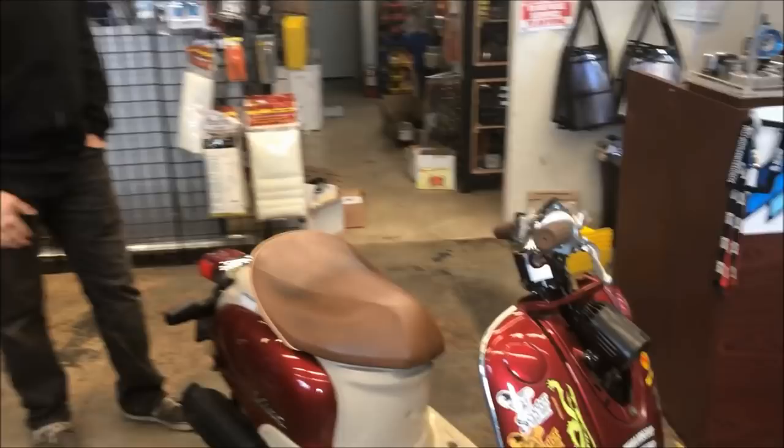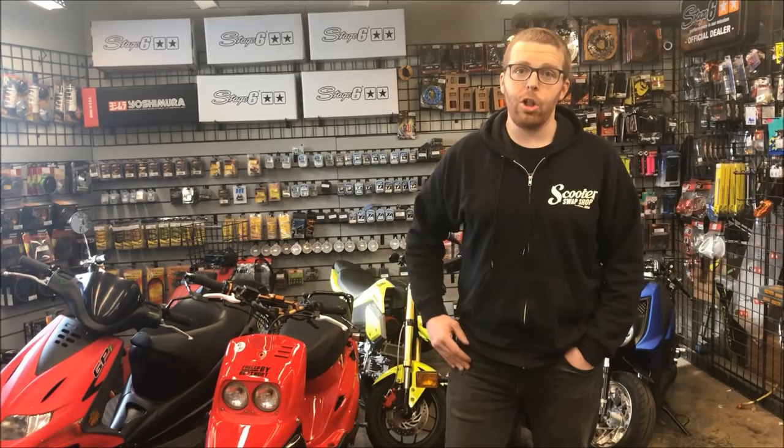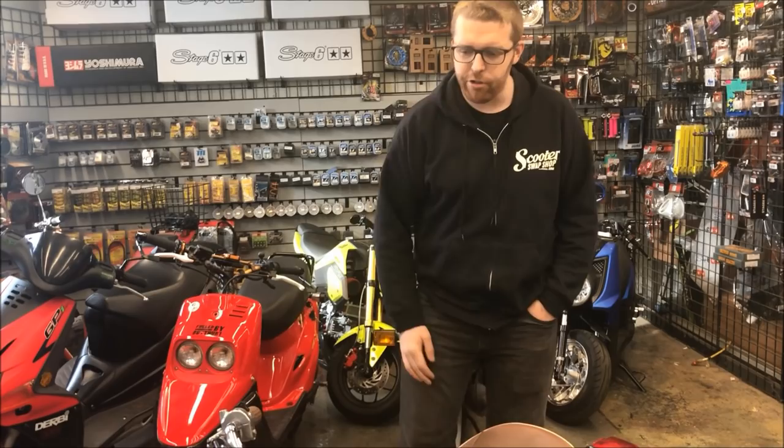Everything else is stock: crank, intake, reeds. The transmission, which I'll post a video on too, is sort of modified, but not extremely. The big thing on any build like this, where you're going for a silent wheelie bike, would be a good clutch. That's probably the number one upgrade you could do in your transmission. Most of these bikes have a pretty weak two-shoe clutch. You want to ditch that right away. That'll heat soak in no time if you're doing wheelies.